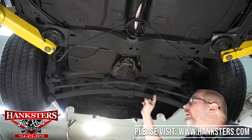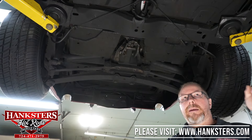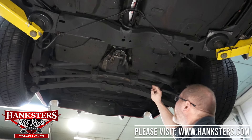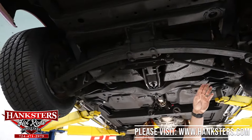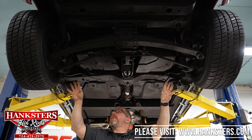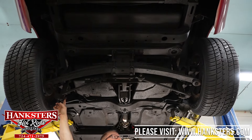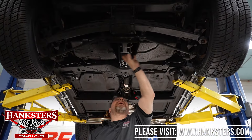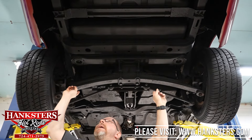I can't remember the exact gear ratio off the top of my head, so check our website — it will be posted there. As far as the rear end goes, you've got your telescoping axles coming out to each of the rear wheels — that's how the Corvettes were done. There's a mono-leaf transverse-mounted leaf spring in the back — that is how the rear suspension is done on this car. You've got your shocks back there too, and the bushings on the mounting ends and locations of the shocks all look to be in good shape. The links for the rear end and all the mounts look to be in good condition.